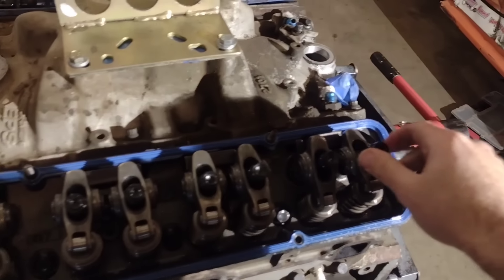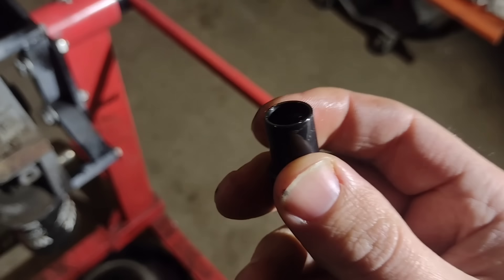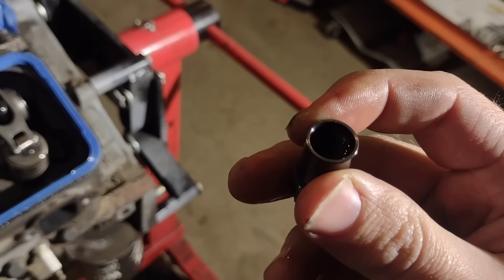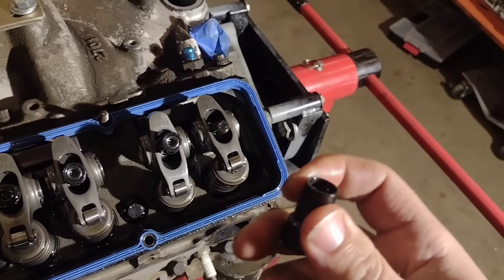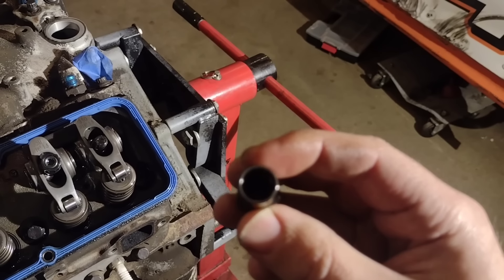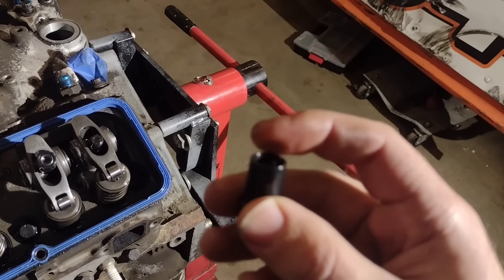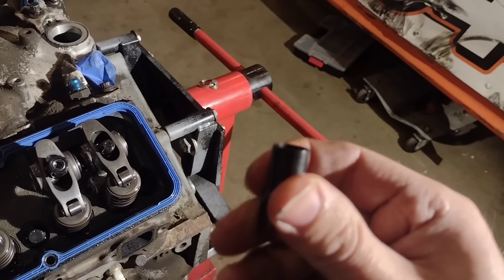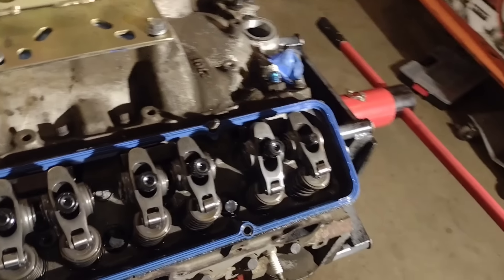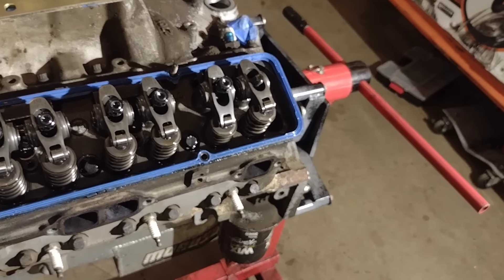I did already start disassembling - pulling this rocker nut off so I could show you one thing. See that shiny spot on the underside of the polylock? I noticed that with these 7/16 studs and these full roller rockers, the amount of surface area that the polylock has to actually ride on the trunnion is so small that it seemed to be a potential area of wear, and we actually did see a little bit of metal flake off a couple of these. These are ARP high quality parts, so I think that's just a matter of aftermarket parts - there are pros and cons to every decision. The 7/16 studs are a lot stronger than the stock-style 3/8, but the downside is that smaller area of contact creating more wear on the underside of the polylocks.